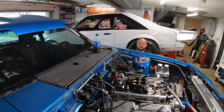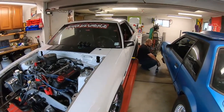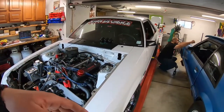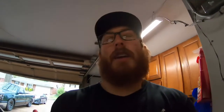My car — nothing's changed. The tune sucked, we fixed it. And then the starter went out last night, literally on the way to the race. I cut the car off because it was getting a little warm, which I'll explain in a second. But I went to start the car and it kicked back a couple times, and now we're pretty sure the starter's dead.